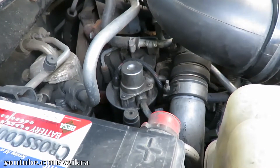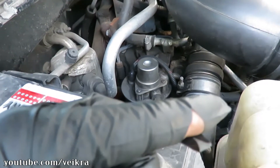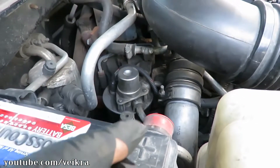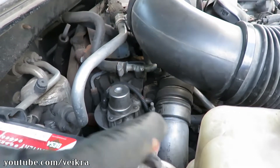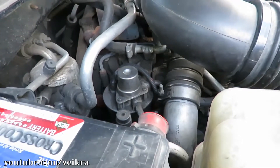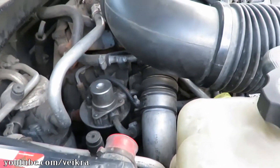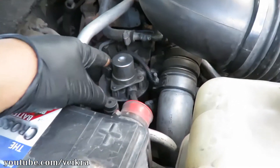What happens is the system is a vacuum system and it can get some brittle lines that shrink up and limit the fuel going to your injection pump. So if you ever have that problem or any kind of a fuel starvation issue, replace all those lines — don't even leave one on there. These trucks are now 10 to 11 years old, so they need to be replaced.